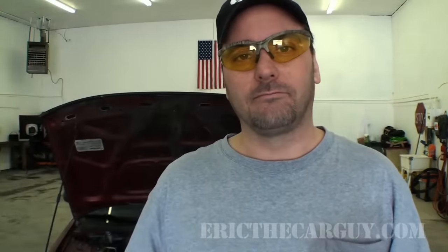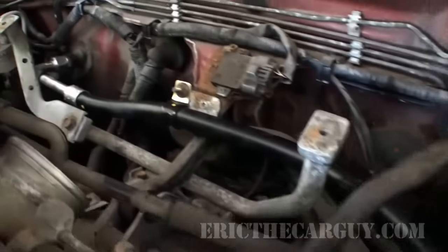I'm glad I did not put that receiver dryer on there, because if what I did didn't fix it, I want to know that now — I don't want to possibly contaminate it with moisture. We'll be back when we get a new hose. Back again for attempt number three on this hose. I'm going to check that the inlet to the compressor connection is good, install this hose, vacuum the system down, check for leaks, and if there aren't any leaks, install the receiver dryer, check for leaks again, and then recharge the system.